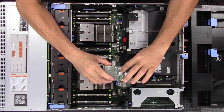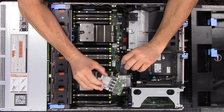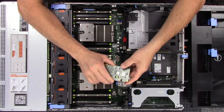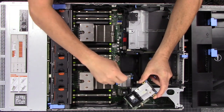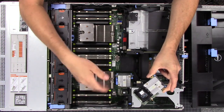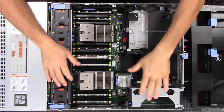Some of these RAID cards have extra memory chips on them, and they hold all the RAID settings — that battery hanging off here maintains the RAID settings when using hardware RAID. You do not want hardware RAID if you plan to use things like FreeNAS and ZFS; you want FreeNAS to have direct control. Therefore, we're going to leave in the H310 in IT mode. That's something important to think about when ordering — making sure you have the right mode settings. The backplane connector doesn't change; you just swap out this little card and it changes the functionality of the system.